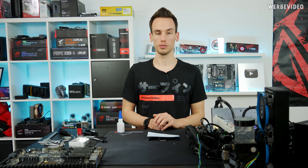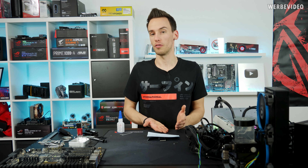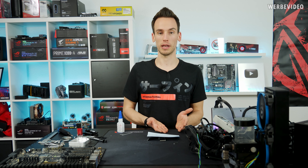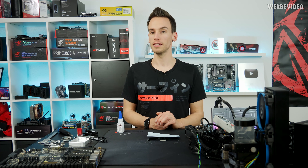My advice on whether to delid this CPU really depends on your goal. If you just want to use it for rendering or professional applications without overclocking, I would not delid it — it's very expensive and the risk is always there. But if you want maximum performance, benchmark records, or those last 100 megahertz, then you should do it — 10 degrees Celsius typically equals 100–150 MHz benefit. At CaseKing we will probably offer these CPUs delidded with warranty, so check the link in my description. Otherwise, I hope you enjoyed this video — see you next time!